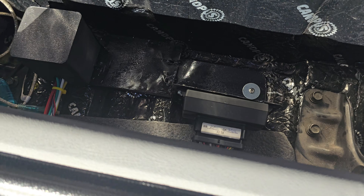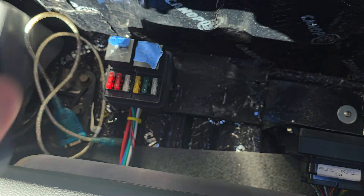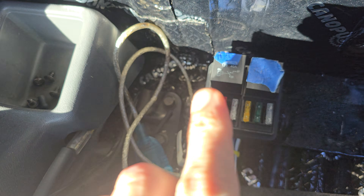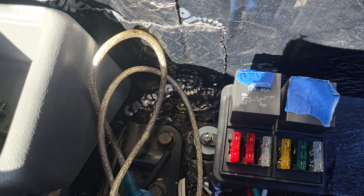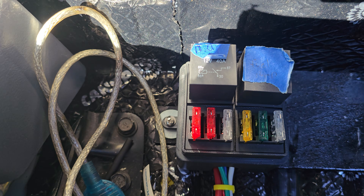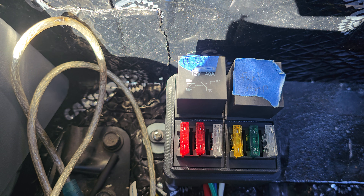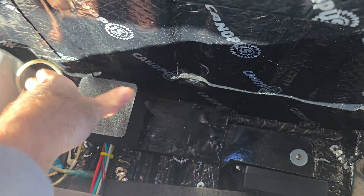Here's the brain of it — we did a Megasquirt. We did this little mounting bracket, and this is all your relays and fuses for the injectors and the fuel pump. All this comes on when you turn the key on and you'll hear the fuel pump. But if it doesn't see the crank signal, it shuts it off, so you're not running the fuel pump dry. We 3D printed this so we have just the right amount of fuses and relays we need, because this engine never came with an ECU — so this is pretty much all wired.